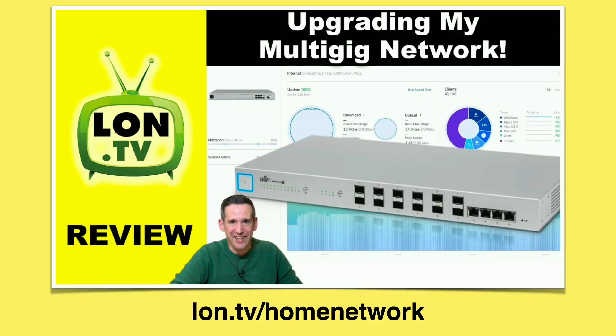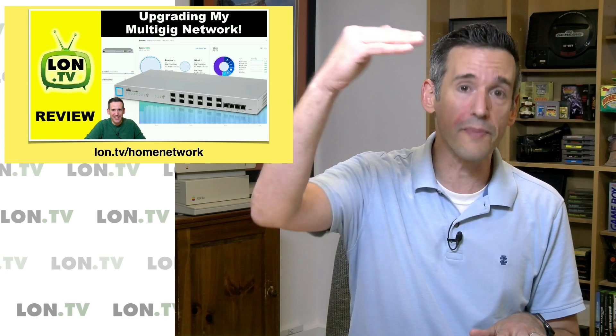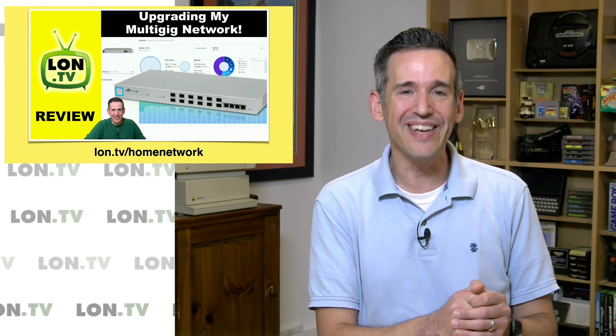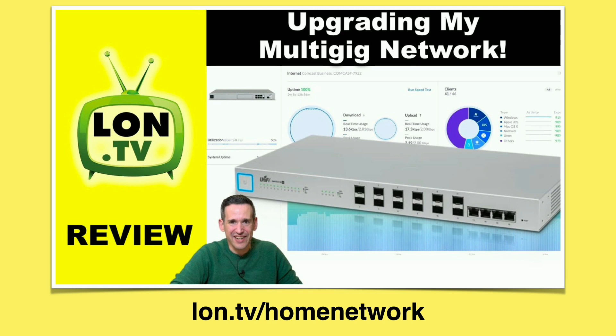YouTube is not the only place I send video to — I also send video to Amazon and Floatplane. My entire upload process now takes maybe five minutes, whereas before it took hours. If you're curious about how my network is configured, you can go to lon.tv/homenetwork to see all the stuff I had to get to make full use of this connection. The only change I've made most recently is to my production machine — I was having trouble every once in a while when pushing a lot of data getting to or beyond the one gigabit mark, my whole network would lock up. I had a feeling it had to do with the network card along with the Cat5e wiring, which is always a big no-no when trying to go multi-gigabit. So I switched out to a fiber-based card, which seems to be resolving things. I have a video coming up this week on that card.